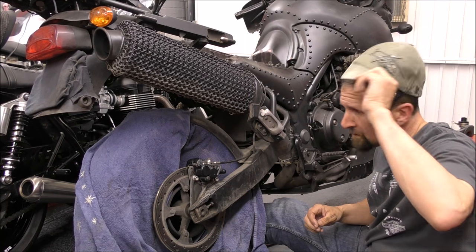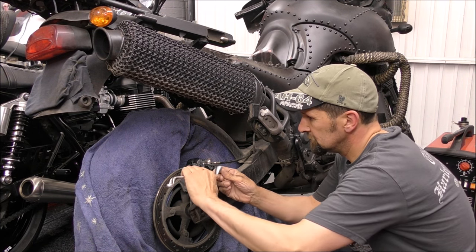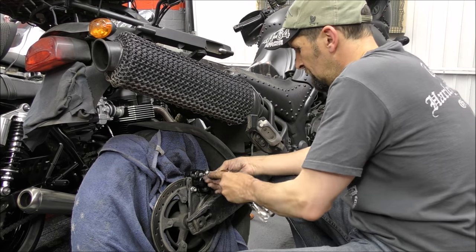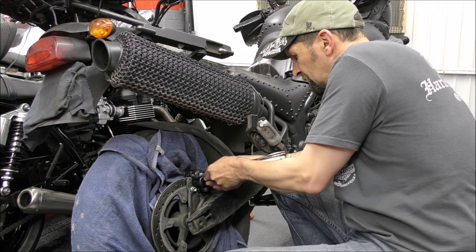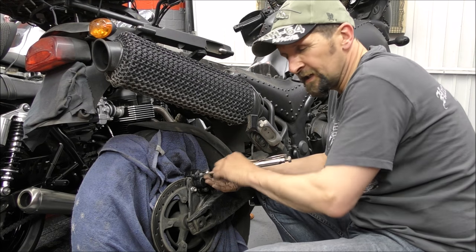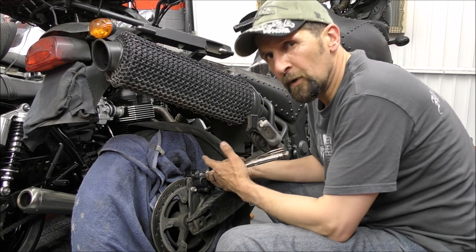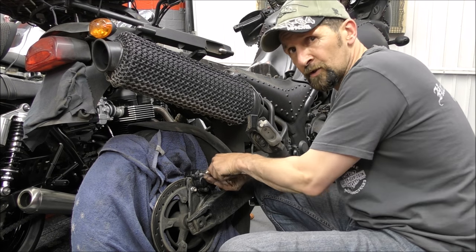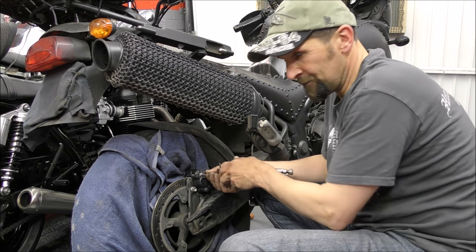Expand the alloy away from the steel. When you get it welded on and start to turn it, don't just lean on it, because the Allen key itself is made from high carbon steel. The process of welding it on, heating it up to about 1300 degrees, will make it very brittle, so it ain't over yet.